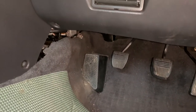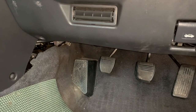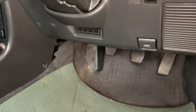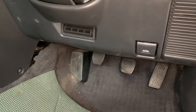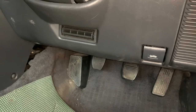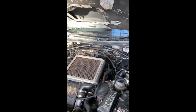I've just tried it — moved it maybe one or two turns, got about a millimetre of travel difference going anti-clockwise, and now I can't even disengage the clutch. I started the engine, tried to put it in first gear — absolutely nothing. So the way to go is clockwise rotation. If you're lying on your back and you can't get the gears in and out, turn the shaft clockwise and that will give you more movement to disengage the clutch. I need to undo what I've done and then clockwise-turn it — that forces the shaft further into the clutch cylinder and gives you more movement.